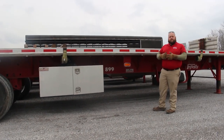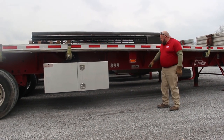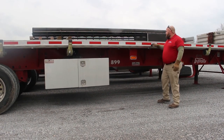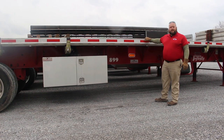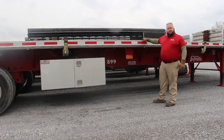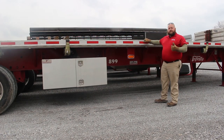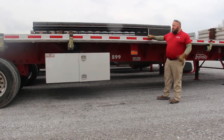When you're loading two coils, you want to spread them out. You can see here the center mark of your trailer outlined. Right above that is a square stake pocket. You want to go five stake pockets back — that's going to be your rear coil. Five stake pockets forward — that's going to be your front coil.